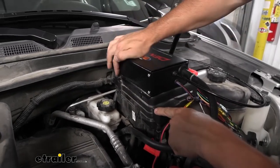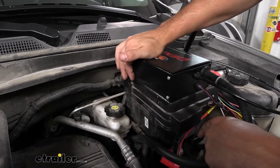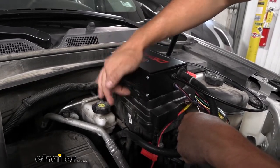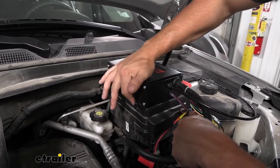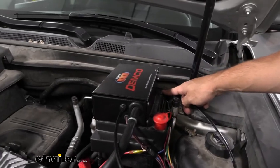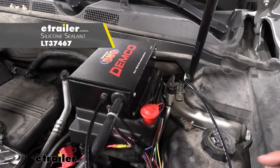For each of the four mounting holes on the side of the unit, I have it attached to the fuse box lid with some zip ties. On this edge, I had to cut off part of the flange because it was going to interfere with the operating mechanism, and this flange I had to bend down. I drilled two holes into the battery box lid, used the zip ties to secure it, and filled any extra holes or space with some silicone. On the other side, I didn't have to alter the flange — I just drilled straight down into the top of the fuse box lid and on the sides, then followed up with some silicone.